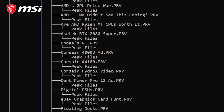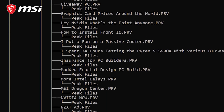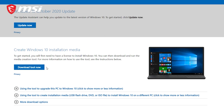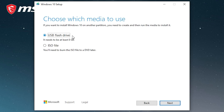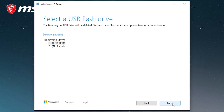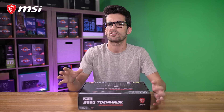First, we can prepare by backing up any data we'd like to keep, including documents, photos, and game save files. Then we need to prepare a boot disk — a USB flash drive with a bootable installer from Microsoft's website. We're going to use the Windows Media Creation Tool, which I have linked in this video's description. With this tool, you want to select the USB flash drive and set that up as a boot device, like so. When this process is complete, power off your system.